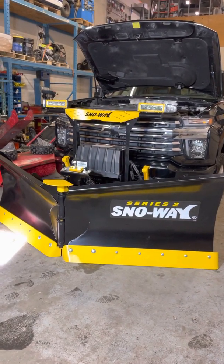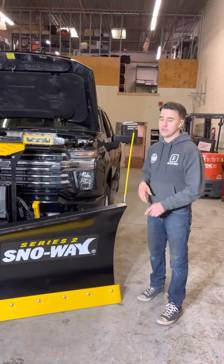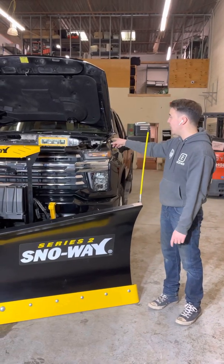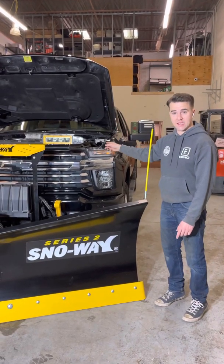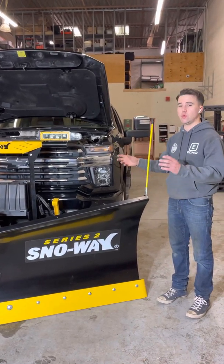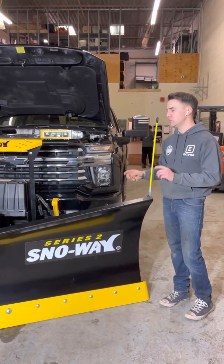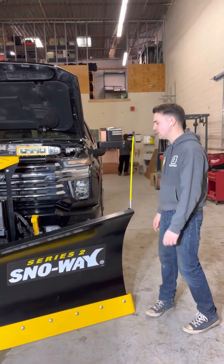On the 3500HDs, on the Chevys, the marker lights and the daytime running lights are actually in a separate system. If they are, you're going to need that little red wire that comes off the ESS — do not cut that too quickly. Make sure that your marker lights and daytime running lights are in the same system; that's a huge must or you'll be doing a lot of splicing.